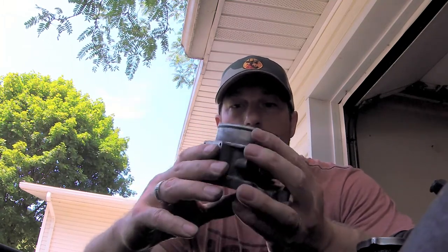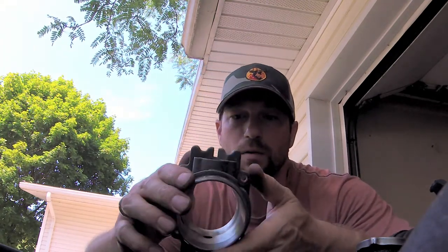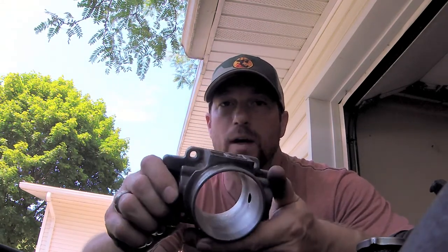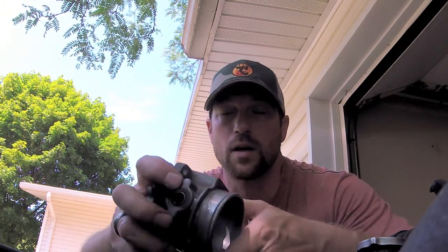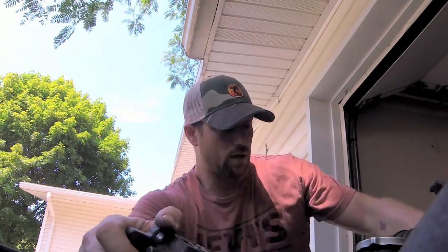For my backyard mechanicry knowledge, this doesn't need to be a precise milled bore just for airflow. Obviously you want a streamlined, uninterrupted airflow through here, but if you did this by hand, I think it would be perfectly fine. When people port and polish cylinder heads, they do it by hand with a hand grinder all the time, and it works excellently.